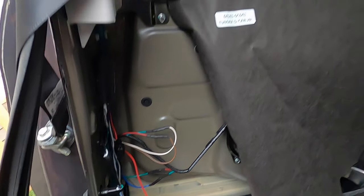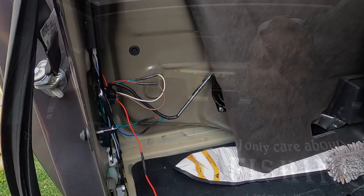That's how you connect the auto lock one touch auto up and down module to the windows that don't already have that capability. Let me show you: on the rear passenger side window, push it once and the window goes all the way down, press up and the window comes all the way up — you don't have to hold it anymore. Same thing on the driver's side rear. And for the rear window, I relocated the switch to right here by the shifter — one touch down, window goes down, one touch up, it comes back up.